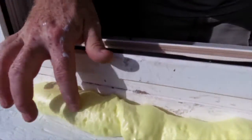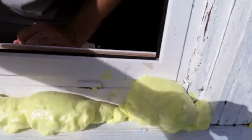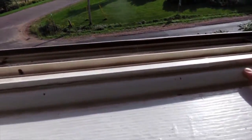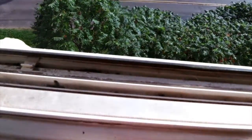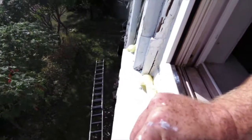I did fill in, so I'll cut this all out and make it nice and square, and then go back over it with maybe some more primer. I didn't have to take this off in this case because I ended up just cutting the sill right along the edge, so the back portion of it is still in there. It wasn't dry rotted as bad as the other one, so that's the process.